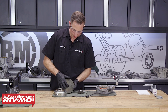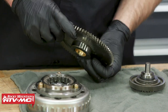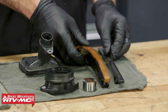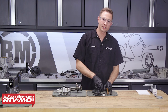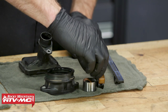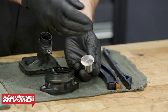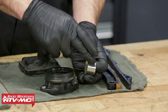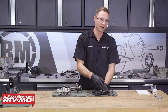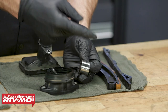On this gear we have a bushing — inspect the bushing, and if there are any visual signs of excessive wear, you want to replace this. Underneath that flywheel we have these timing chain sliders. For the sliders, we just want to make sure that the cam chain didn't make any deep grooves in them — if these sliders have deep grooves, you definitely want to replace them. Back to the valve train components — these buckets, you just want to look for major damage or scoring. If that happened you're going to have serious problems with your cylinder head, but a lot of times these are okay. These need to spin freely when installed on the cylinder head.